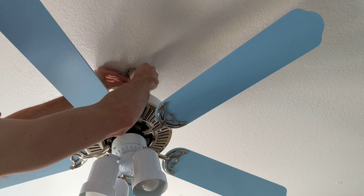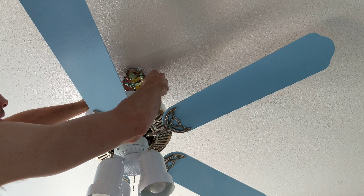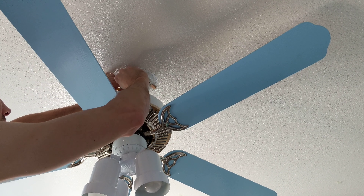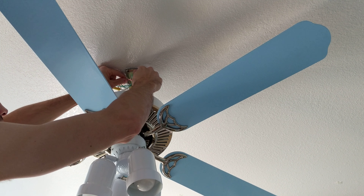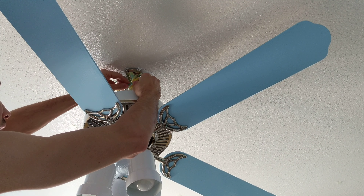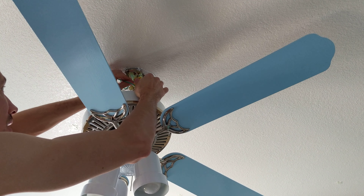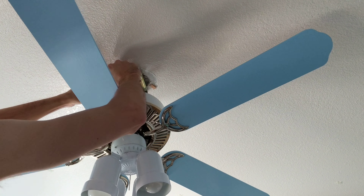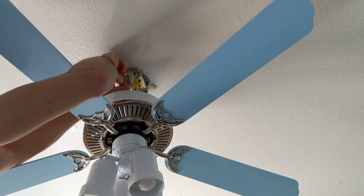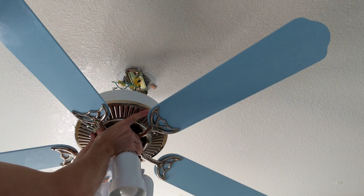All the black is attached to the black. Let's go ahead and remove the motor wire and put that back on there. Remove the ground. Take out the neutral there. So now our fan is free and we can remove it.